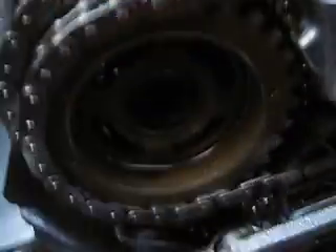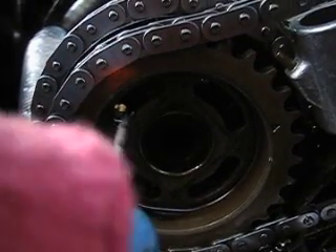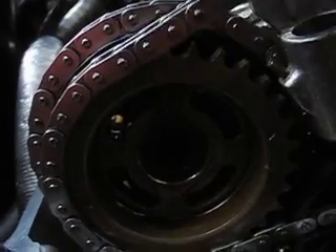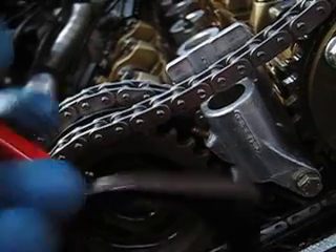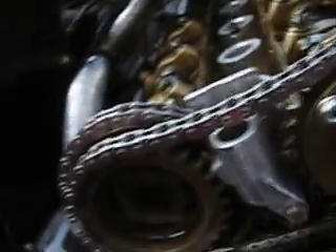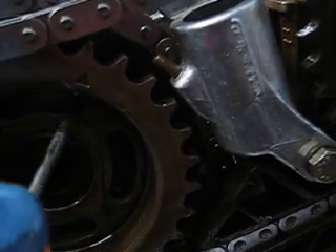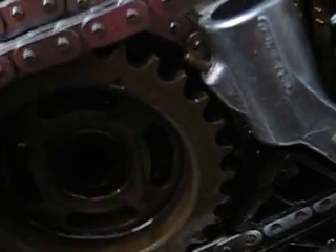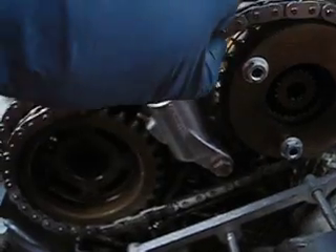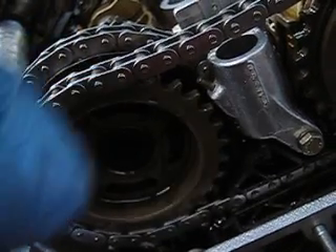Moving back to the front, with the chain pulled all the way in one direction, the threaded holes on the camshaft hub are aligned all the way to the left of each slot. Using the sprocket turning tool to fully rotate these in the opposite direction, you can see the holes are now aligned all the way to the right of each slot. This will allow full travel between the two sprockets. This is a common mistake made when timing these engines, because you can actually be one tooth off and the engine will still run — though the timing will be off and it will run very poorly.